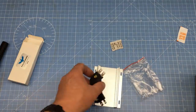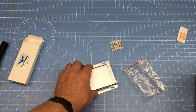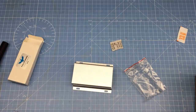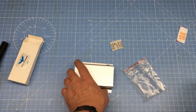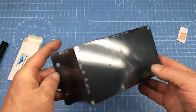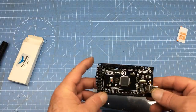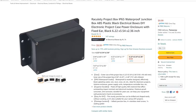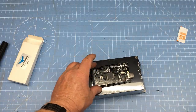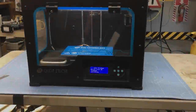For the ignition module, I picked up a nice-looking aluminum enclosure, because I like to make stuff look nice — plus the module really ought to be mounted to something to dissipate the heat. The Speeduino NO2C doesn't have a suitable enclosure available unless you 3D print one. That's why I went with an ABS plastic enclosure, because 3D printing enclosures always ends up taking too much time. However, I'm not opposed to 3D printing a mounting base for the Arduino Mega, so let's do that.